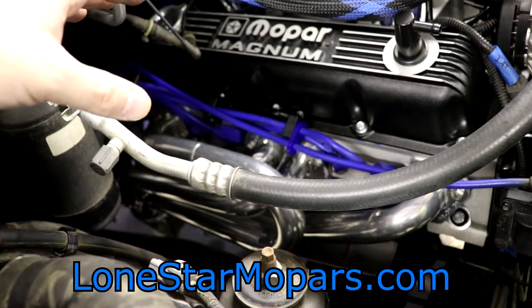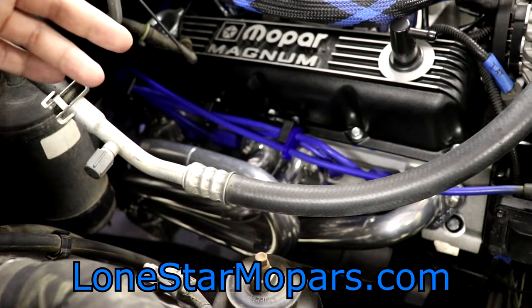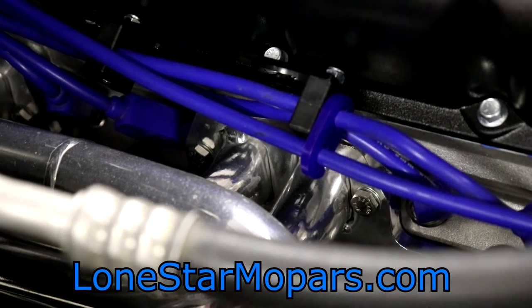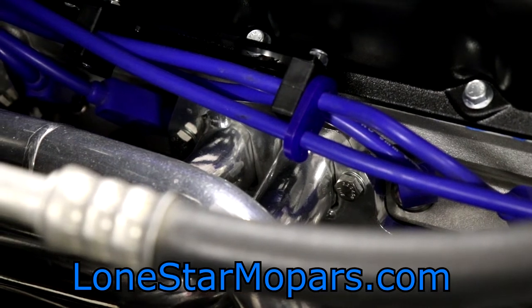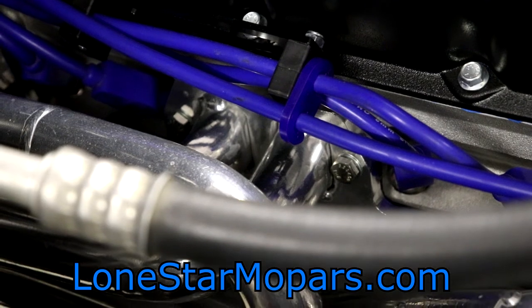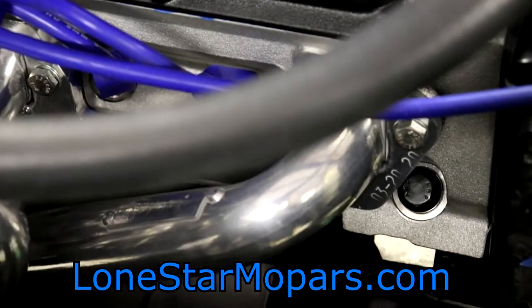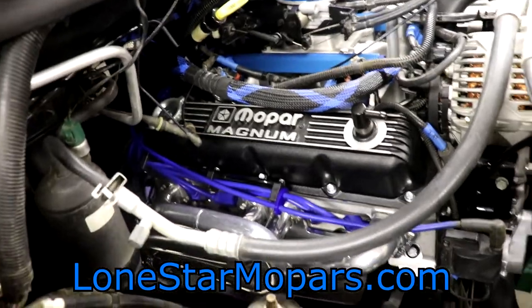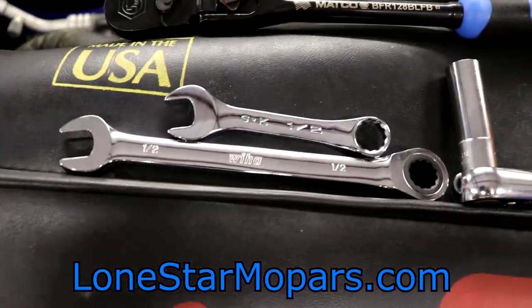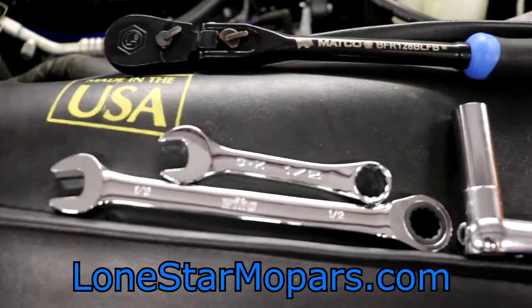For all intents and purposes these have to go in. If you've never dealt with headers on a small block Mopar, you might wonder why Pacesetter just had welds on the inside of the primary and didn't double-side it — I'll show you why. If you look at my stainless bolts, there's like not really room for a socket. You can come in with a wrench, but an impact socket's probably not going to fit. Thin-walled impact, maybe. Bottom line: it's tight quarters — those are 5/16ths bolts so we need half-inch stuff. I've got an arsenal: the VEHA half inch, a ratcheting combo just in case, my stubby SK — one of the reasons I pulled the trigger on that for tight confines.